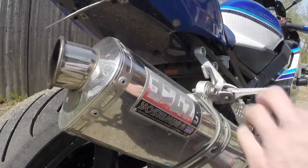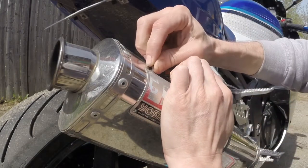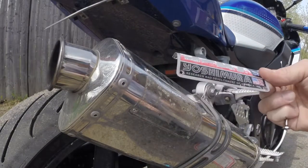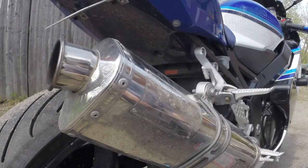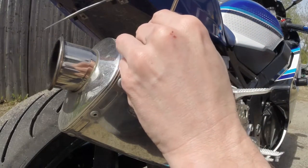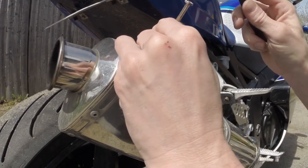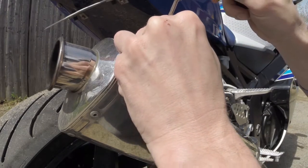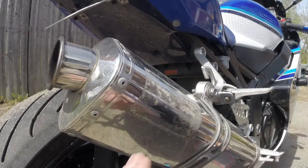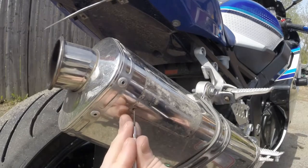The job is small so I didn't sweat too much what tools I was using — any drill should be fine. Then very carefully pry the old badge off. Take a small screwdriver and pop the old rivets out into the muffler. Now we're going to end up with four little pieces of metal floating around in the exhaust, which is not great. I'll be repacking in the near future so I'm not too worried, but you might want to get creative about getting those out.